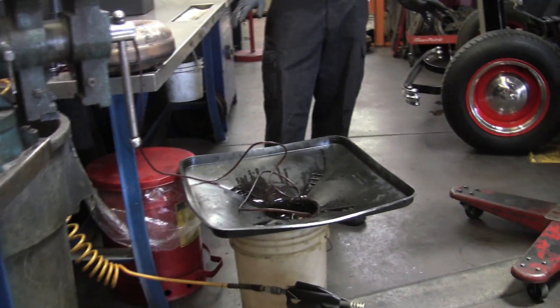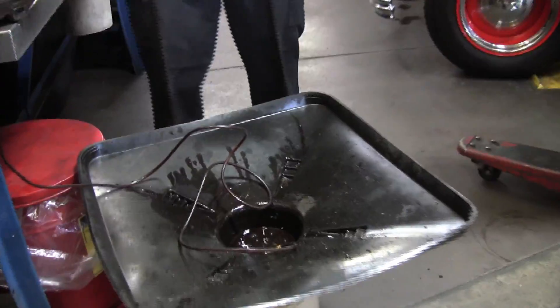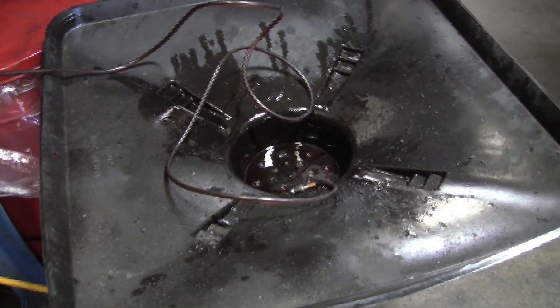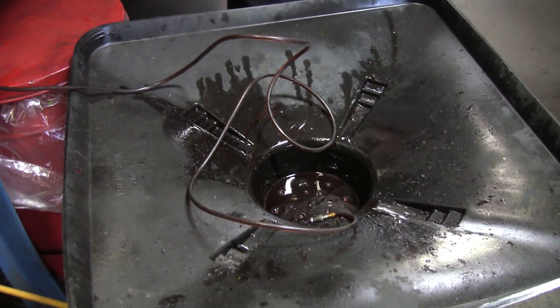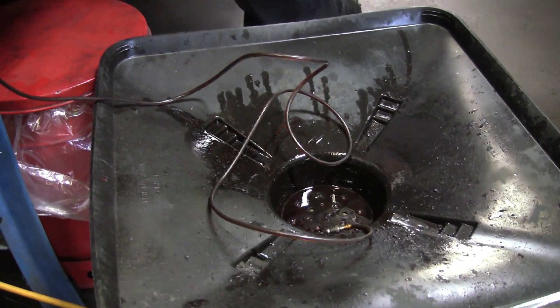The Silver Cloud — I love those. They have a two-piece torque converter but it has a drain plug, so you can drain the torque converter, change the filter, or clean the filter and service it.